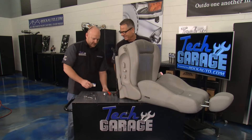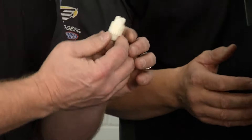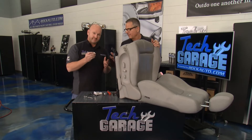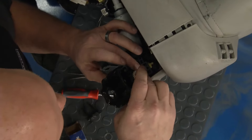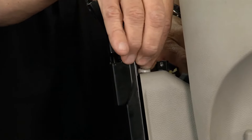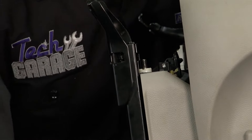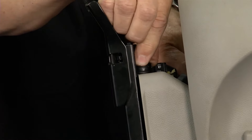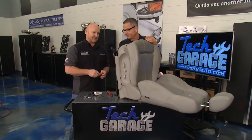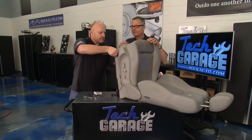There's the teeth. Let's go to the RockAuto toolbox - we've got extra seat parts and I think we've got the right worm gear. The whole apparatus - Brian was talking about $800, $900, could be $1,200 just depending on the car if you have to buy this whole seat apparatus. But $4.50 - got a new gear. It's just a worm drive, so it can go in at any index. There it goes down in there and you can feel it's tight. Beautiful. It's a matter of just putting the plate back on, the washer, and secure it. I'm pretty confident that's going to solve the problem. For $4.50, we're good to go. That's at least a $796 ROI.